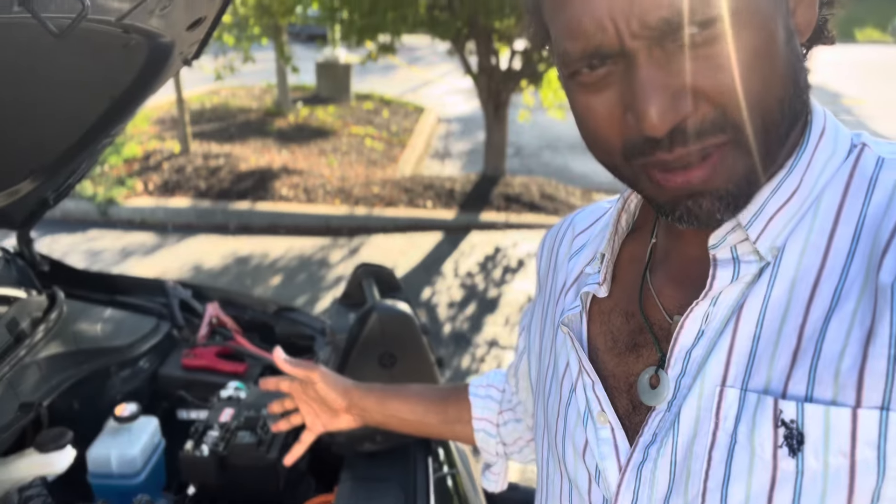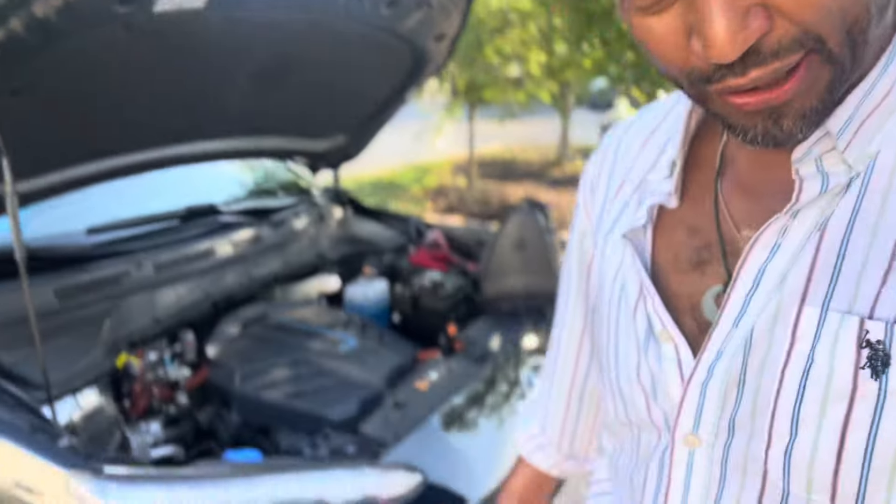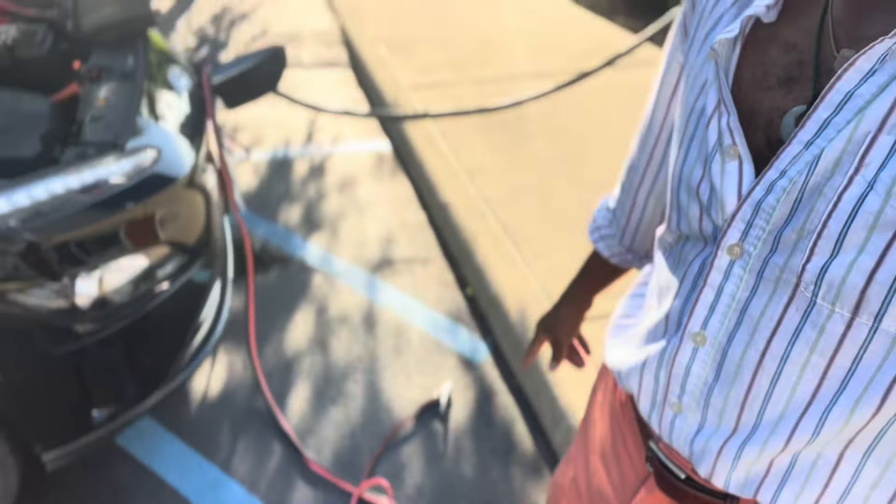But if that 12-volt battery isn't working properly, you're not going to be able to charge your car even though there's a charge available. It's convoluted. My little jump box has been jumping the car so much it finally went dead today, and I had to call a friend — that's what the jumper cables are for. He came to help me jump the car so I could plug it in and charge.